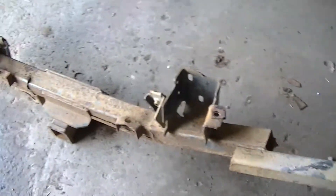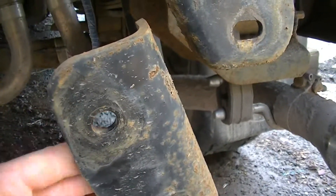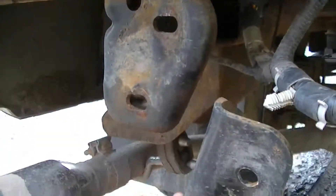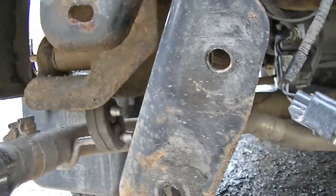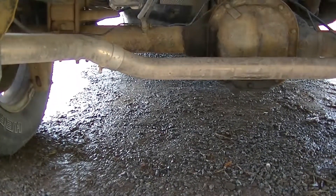So with the new draw-tight hitch, there's no way to mount the bumper to the truck. As you can see here, I still have to remove these. I got this side kind of loosened up. This is the factory tow package — the wings, I guess you would call them — and this is part of the frame rail. This is where the factory bumper mounts would go, this side and this side. This one I got to take off — it's a three piece. The factory tow package is a three piece. So you have this piece, this piece, and then the hitch assembly — and it's all bolt-on. We're replacing it with a one-piece welded draw-tight assembly.